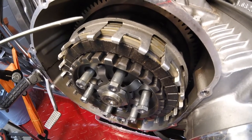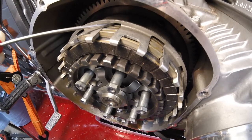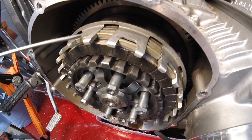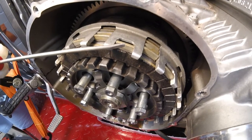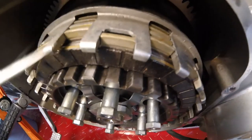It is worth noting before we do it that all the friction plates from back to front fit between the upstands on the clutch housing, with the exception of the last one — the outside one, the one we're going to take off first. That one fits one round and fits within the upstand of the clutch housing.